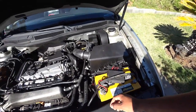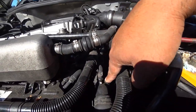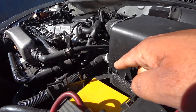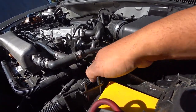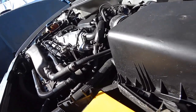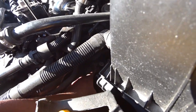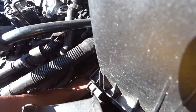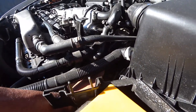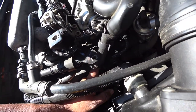One very important thing on Mark IVs: these coolant hoses down below where my hand is. This one is notorious for cracking right here, down by the air box and the coolant sensor. If you have the opportunity to get the air box out of the way and see this area — see where my finger is? It looks like it's had a coolant leak for a while, that's why it's all white. That's a good sign that this coolant flange right here is bad and it's time to replace it.